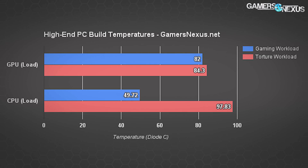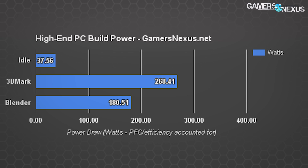CPU temperature under the gaming workload with performance settings for the cooler stayed around or below 50°C. When we tortured both the CPU and GPU simultaneously with synthetic workloads — Prime 95 and Furmark running at the same time — we were easily hitting 98°C on the CPU. On an open air bench we can stay below 90°C under these conditions, but boxing it all into one case really shows the difference, as we're having trouble exhausting air as fast as it's heating up.